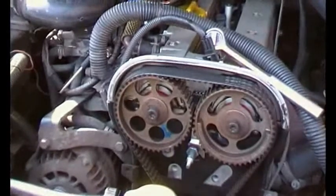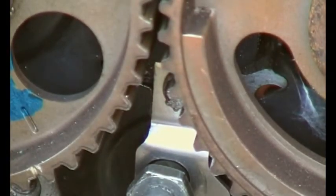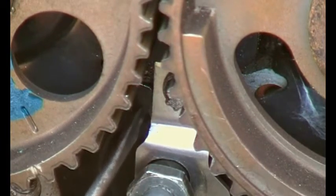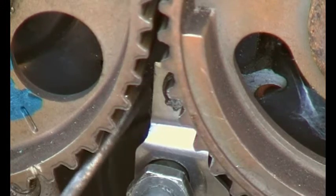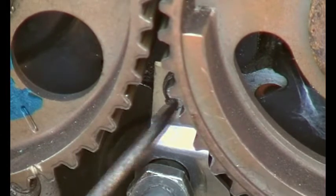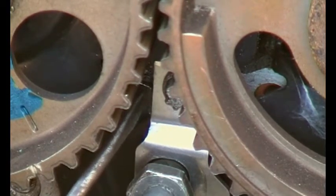With a little bit of grief I've got the new cam sensor back in place. Can you see it there? This bit here sits against a shoulder — there's a bit of steel there and a shoulder. The bolt wasn't going in because the fork around the bolt wasn't lining up slightly, so I had to take the merest wipe off this piece just against that shoulder to get the bolt to go in. Hopefully the sensor is still in the right place — half a dozen wipes of a file shouldn't make any difference.